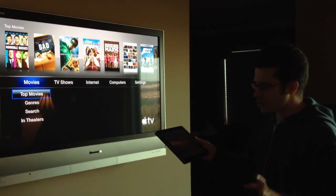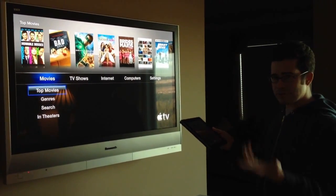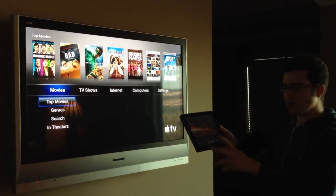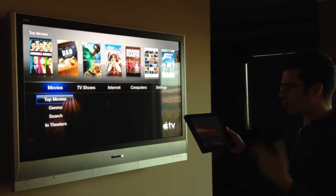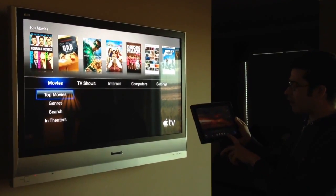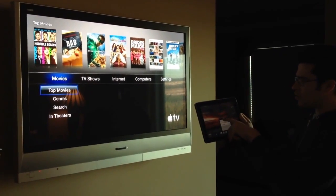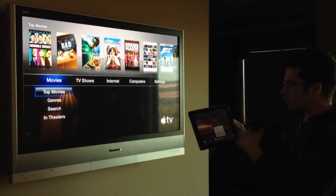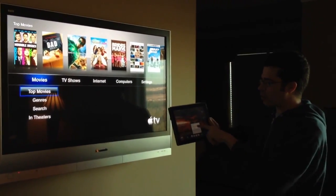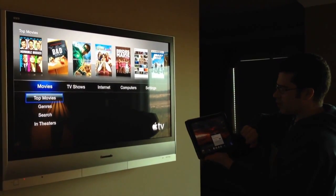All you need to do to turn on AirPlay mirroring is really simple. Pull up your menu — your taskbar, all the open applications. Slide to the right to reveal a deeper menu where normally you would see play, fast-forward, or rewind icons for whatever music's playing on your iPhone, iPod Touch, or iPad. But now you'll have this familiar icon to connect by way of AirPlay. I've got two AirPlay devices I can currently sense — I can push the data onto the iPad, or the bedroom Apple TV. So I'm going to put the check mark in there and slide on mirroring.